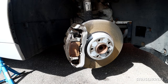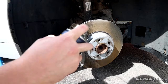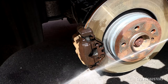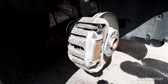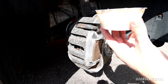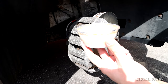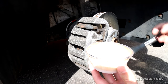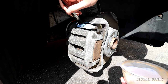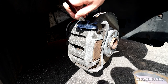Just to try and help remove any last bit of brake dust. Now with the calipers nice and clean and dust-free, we can start applying some of this rust converter. This stuff goes a hell of a long way — only have a tiny amount here and this should be more than enough to do all four calipers, just the bits we need to rust-convert. We haven't got to be too careful about where we get this; it doesn't matter if it goes on to the other parts, it's just not really going to work on those.